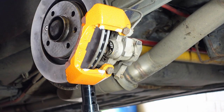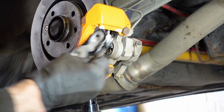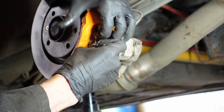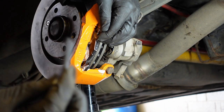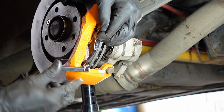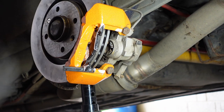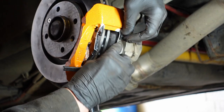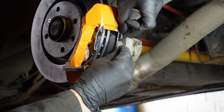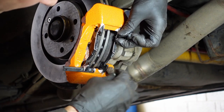We have some springs here — these springs are absolutely critical. Never leave them off, no matter how difficult you find it is to fit them. Always fit those springs. It springs and holds it in. Then you get your little slider bar, and that goes in like that — holds the first pad in. Can't come out. There are people that say these setups are rubbish and the springs always pop out. But if you fit them correctly, guess what? They don't fall out! Why would a manufacturer design a brake setup where it would fall out?